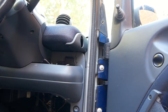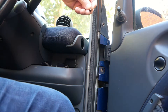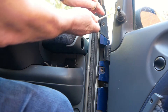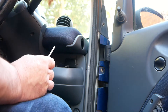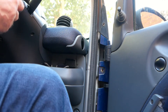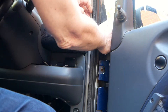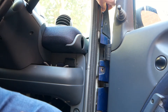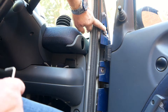I can do the passenger side — it doesn't make any difference. I'm going to work through these now. So this was held in with a self-tapper, which is the wrong fitment. It should be a little plastic cap that fits in there and then expands as it's pushed in. I'll replace it with the right fitting. Use a little tool to ease that off — be careful, keep your eye on it. That will just pop off and reveal one more. Keep them somewhere safe.